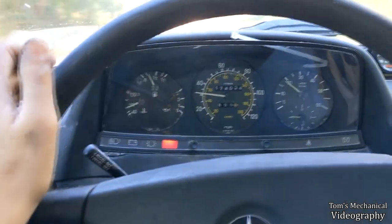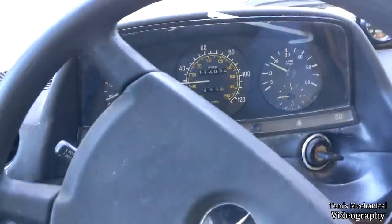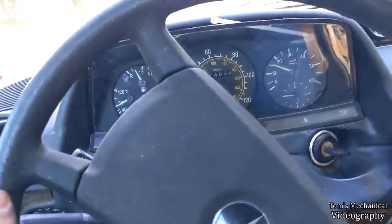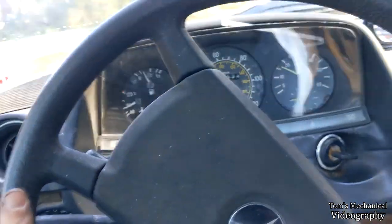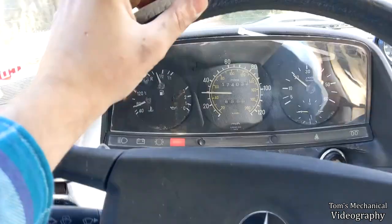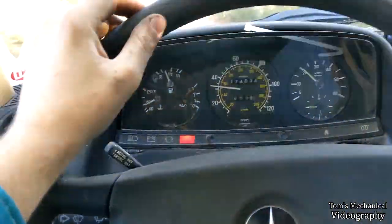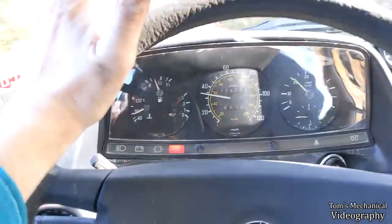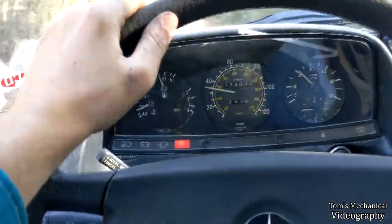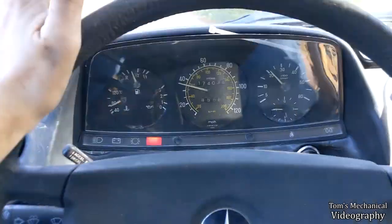So, I think I'm going to go work on some more accessory fiddly bits, and then figure out what parts I need to buy for the suspension, get a new transmission mount and new flex joints for the drive shaft, get those in. That should cut down on all of this drivetrain vibration, some of the parasitic loss, the fact that that guy shivers.